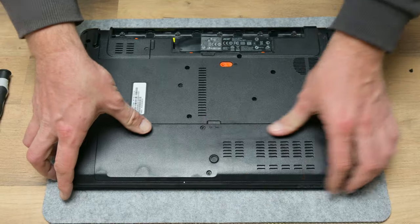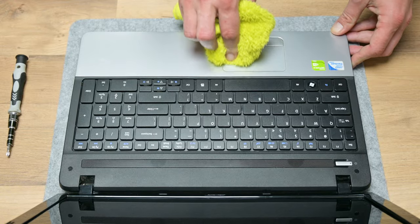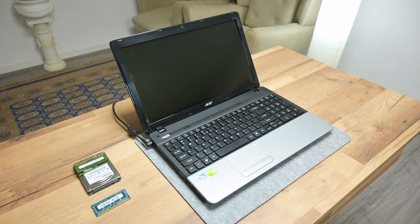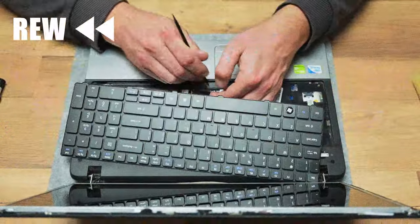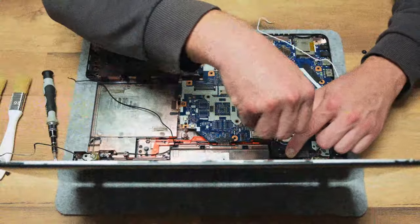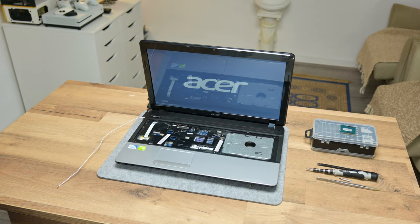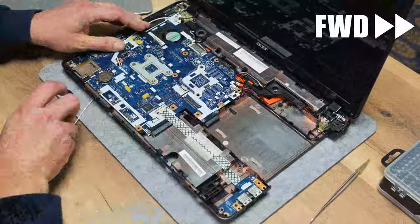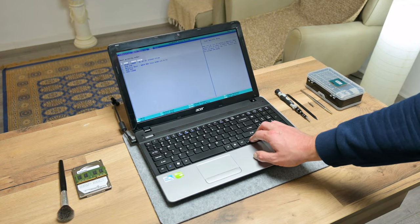After assembling the laptop and doing one final cleaning and brushing, I thought everything was good and the laptop was ready. But the laptop would sometimes start and sometimes not. So again I went through disassembling and testing, and found the problem was coming from the CPU. I replaced the CPU and the laptop started working normally. I ran in-depth testing and assembled the whole thing again. The last batch of CPUs I got were very cheap, and with old hardware this can be expected.